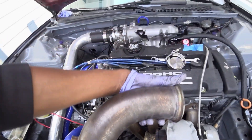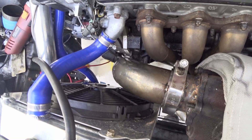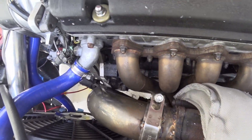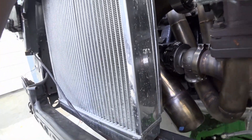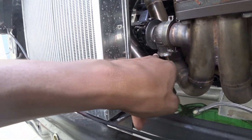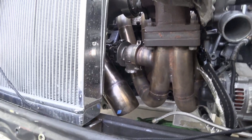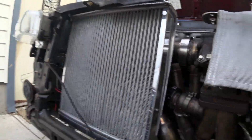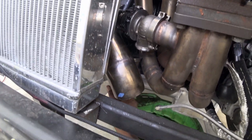We may have to shorten this section and bring it in a little bit. The downpipe is basically mocked up now, I'm just gonna do the last bottom section. It's pretty elaborate — it goes through there, comes around with space for the wastegate. We're basically going to cut this up a little bit and shorten it.